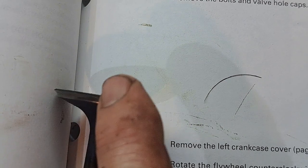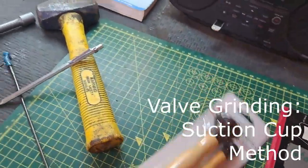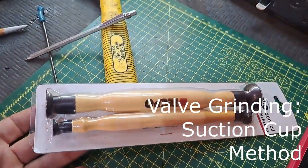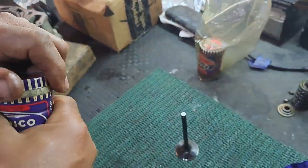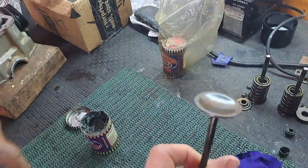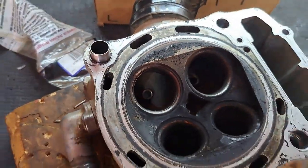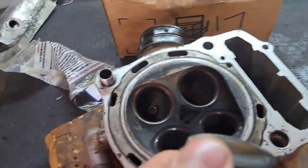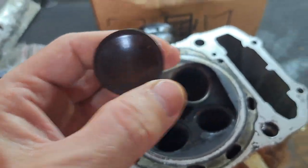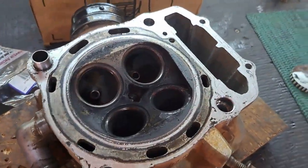New day, new game. We are going to start grinding in the valves with grinding paste. We've got a brand new valve - we've marked it so we know which side is which. We've got the grinding paste; we're going to put a little grinding paste around the rim of the valve and then go waga waga waga in there with these suction cup doohickeys.